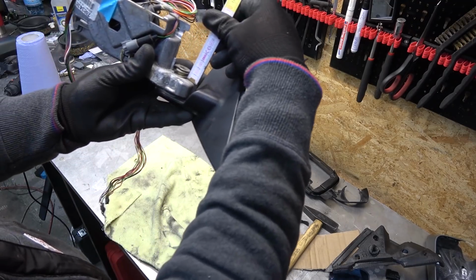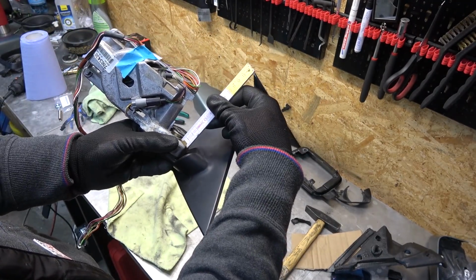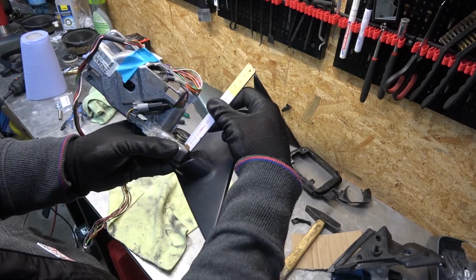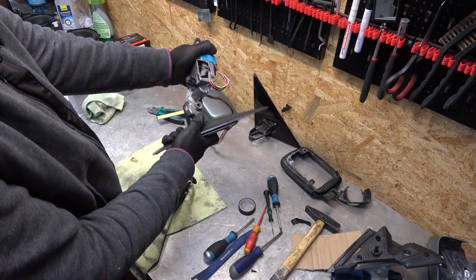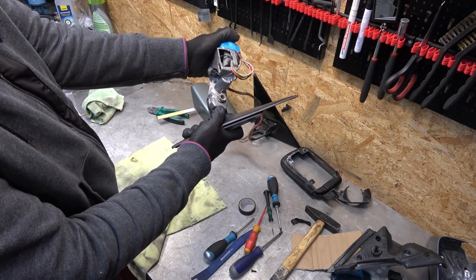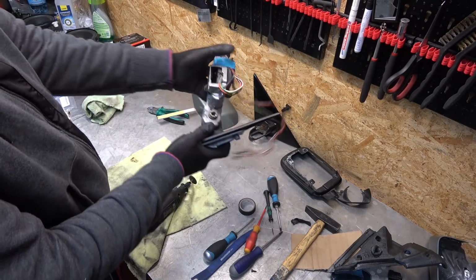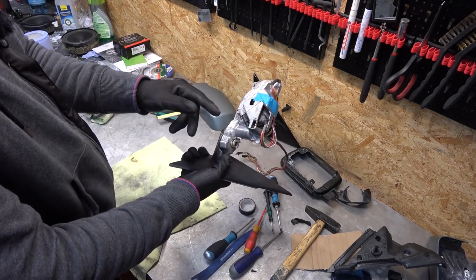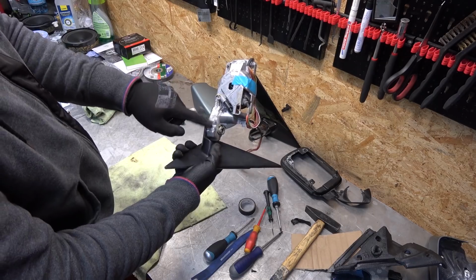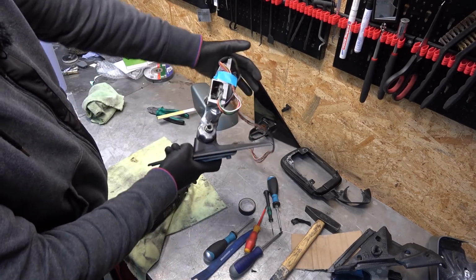I'm gonna measure the top spring here and basically put the same tension with the bolt and nut later. This is how it works, actually. This is what the spring does. It puts pressure onto this arm and then you can fold it like this. But when the power folding function is active, there are gears and motor inside that wind it, and that's how it closes.